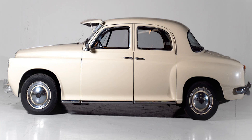The 105R model has its own unique Rover Drive gearbox, a two-speed automatic with a fluid flywheel and overdrive. This box is not efficient and comes with a penalty for both economy and performance, but it tends to be reliable. Spares, however, are hard to source. While they share their oil with the engine, many owners will miss the drain point on the gearbox and old oil can be left swilling around for years. Check it's been done.